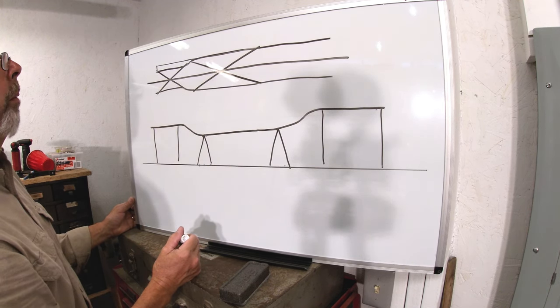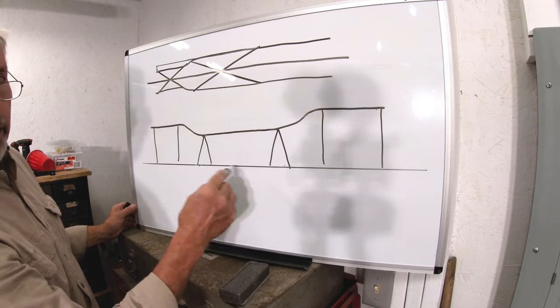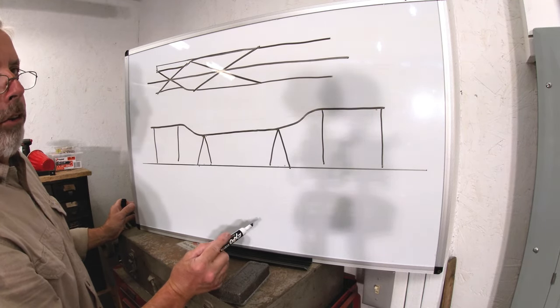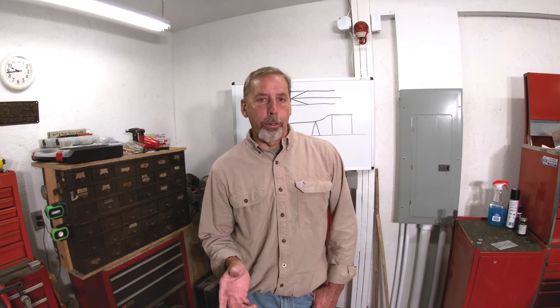This is something you can do at home in your garage. The only drawback to this system — if you're going to do any pulling on the frame and that car moves, all your marks are no good anymore; you've got to start over. But just to assess a frame and get a good measurement of what damage you're looking at, it does work pretty good. On the plus side, this is probably the cheapest frame measuring system I've ever seen. I didn't have to buy anything — had everything laying around. You can do it with the vehicle still sitting on your tape marks, though it's a little harder to see. It'll give you a good understanding of what your frame is like — if it's bent, if it's straight, where it's bent. I'm kind of impressed with it. I've never measured a vehicle like this; I heard about it years ago and wanted to give it a try. If you like this video, give me a thumbs up, leave me a comment, hit that subscribe button. Thanks for watching.